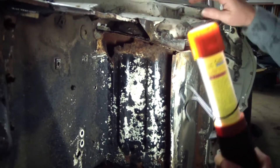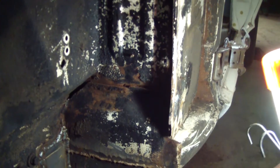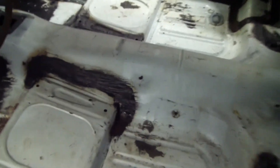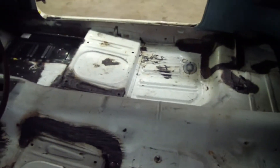There's another panel between here — it's just a series of panels all sandwiched together. There are three layers; everything is always folded over so that it gives it rigidity, but each layer of sheet metal is just paper thin. We're removing all the old petroleum-based seam sealer, then we'll use lacquer thinner, get this thing all cleaned out, scuff it down, and paint it. Then use seam sealer where all the patches are, and then he's going to use that truck bed liner — that kind of dampens sound and it'll seal it up so it won't rust out anymore.